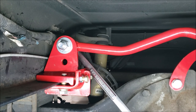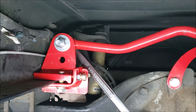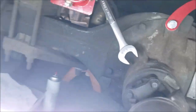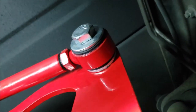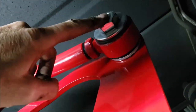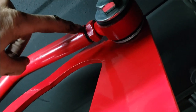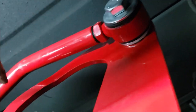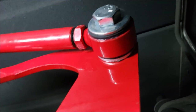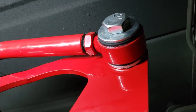Now then, what else we got to do? We just got two more steps. Let me get the camera down here. Okay, last thing to do, same like I did that one over there, I gotta torque this one up to 150 foot-pounds. The last step is I gotta put me some Loctite in there, and on this jam nut, jam it back. So let me get that done, and then we'll do a final once-over, make sure we got everything correct and nothing's rubbing anywhere.